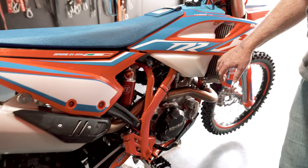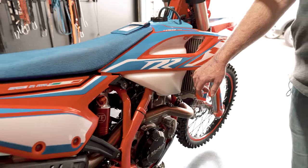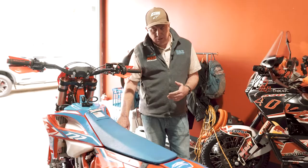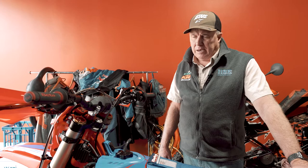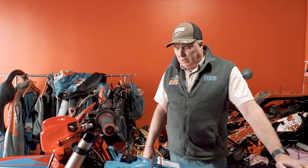One thing the average trail rider is probably going to need to address: I've boiled this once in some pretty heavy going. I opted not to get the thermo fan from day one — I wanted to ride it and see if it boils first. What I'll do now is put some really good radiator fluid in, drain out the standard stuff, and if it boils again I'll add a thermo fan. I think they're about $380 fitted.